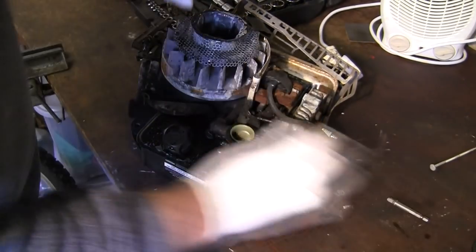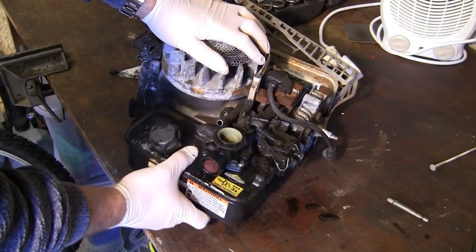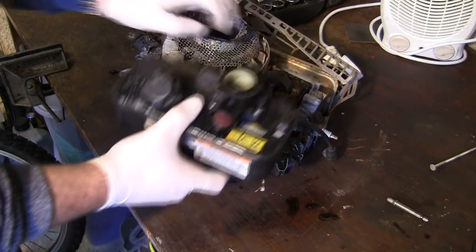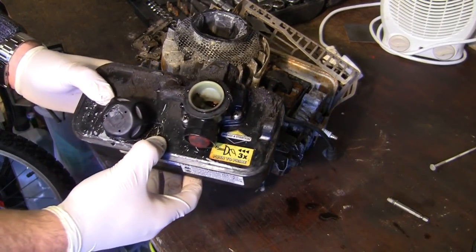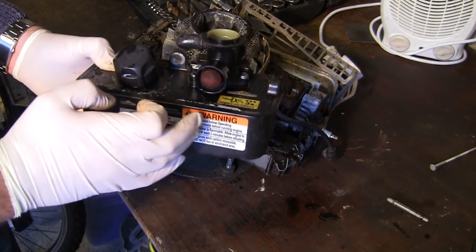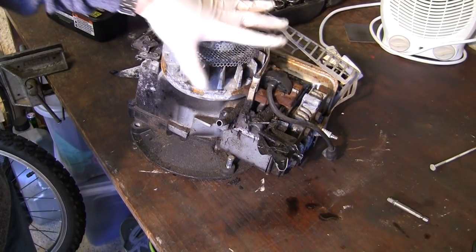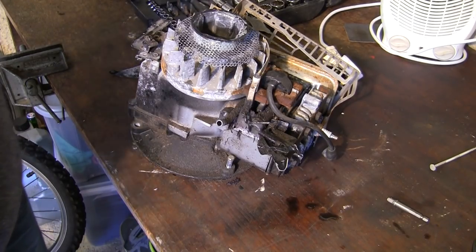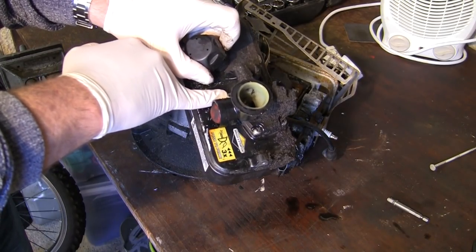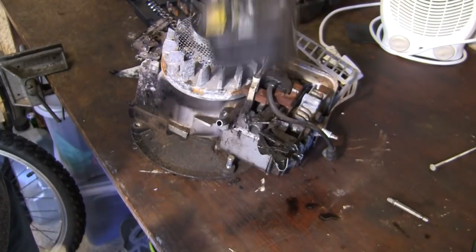Take that off there, and if you've never seen this before you'll be kind of amazed - take that part out, it comes off, and then the whole thing just pulls and there's a little linkage down here swinging around. If you tilt that - look at that - the whole thing has come off the engine. This is what you'll normally just need to do when you get a lawnmower that's revving up and down and not running right. If you can learn how to do this one repair, you can make yourself some extra profit. I'm going to move this all out of the way, clean it up off camera so I can work on it better, and show you how to service this carb.